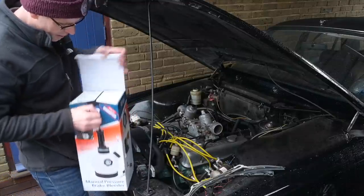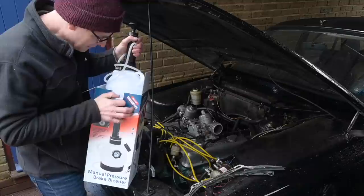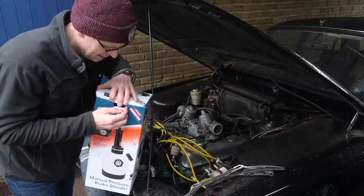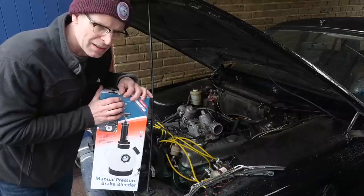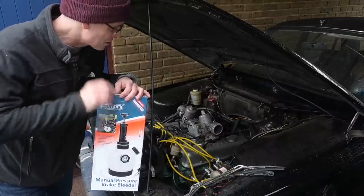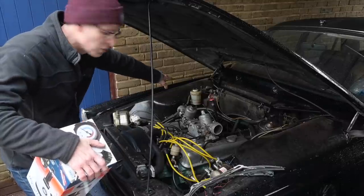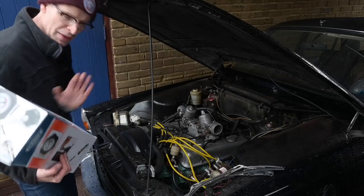I did get this rather lovely new Draper — it's not an illegal item, it is a pressurizable brake bleeder, a one-person brake bleeder. I've got one of those horrible one-man easy bleed things but they're terrible — they work off the spare tyre pressure, so they start off at such high pressure they blast fluid everywhere, and then they quickly get to so little pressure they don't do anything — just a waste of time. So I needed to get this one. Unfortunately it doesn't come with the different adapters — you need to buy that as a separate set. And this hasn't got the same size adapter as on the car, so I'm waiting for that to arrive, which will be in the next video.